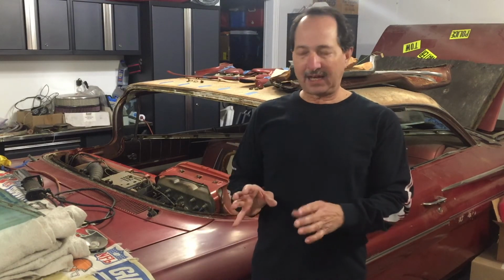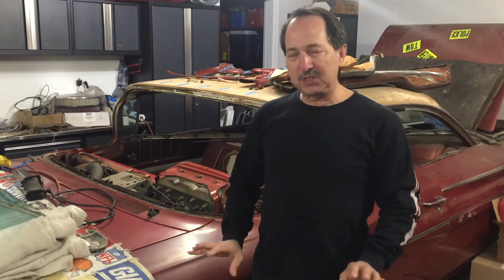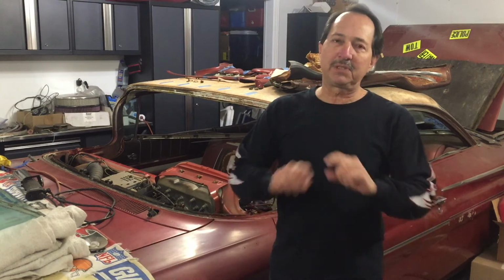I think it was a late 80s, early 90s Cadillac that has the power trunk pull down. So it has the trunk release, but it has the pull down. Now, if I go with really tight gaps, when you slam these trunks shut in order to get them to latch, if you want the seals and everything to be nice and tight, you chip the edges of the trunk lid. I did it with a '69 Camaro show car, and I wanted all those nice, tight, straight gaps, but then I was always having to be really, really careful. And if somebody slams it, it chipped off the edges. And that did end up happening after I had the car for a few years.